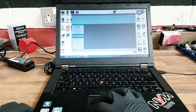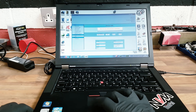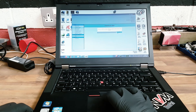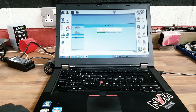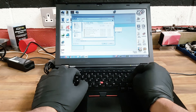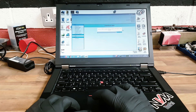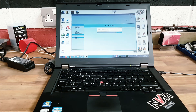Now you can see the device info, which will bring up the vehicle details — the VIN number and software and hardware details of the ECU. If you go to download data and press start, it will take all the data off the NVMR onto the PC so you can save it. You can type in the file name and save that somewhere.